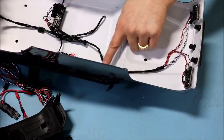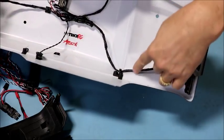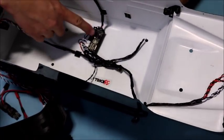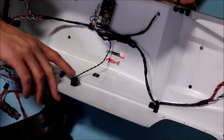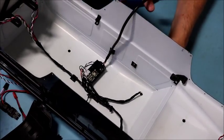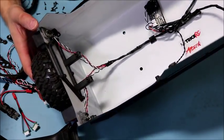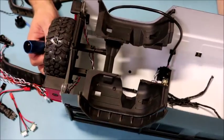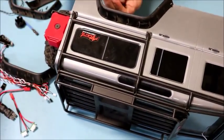We chose to wrap our wires to give a more finished look. The Dragon controller is mounted using a zip tie mount. We ran the mode button up one side so it's easy to access without lifting the body too much, and the power cable comes off the other side. The tail lights and reverse lights look very clean and minimal with the light system installed.